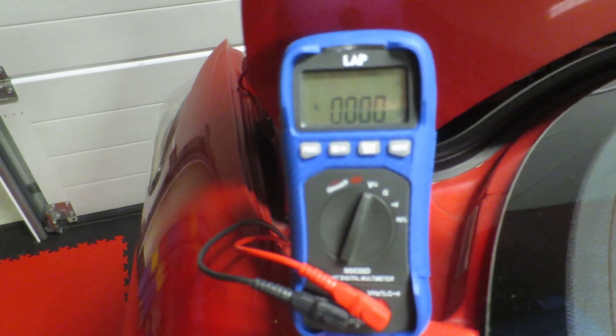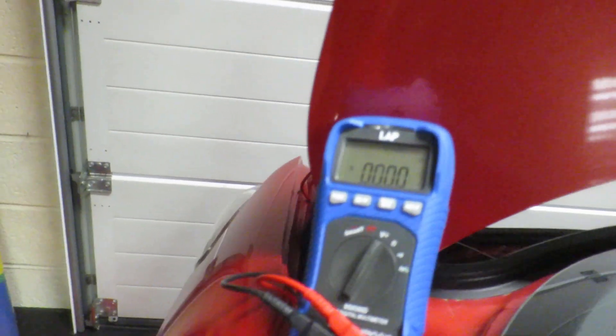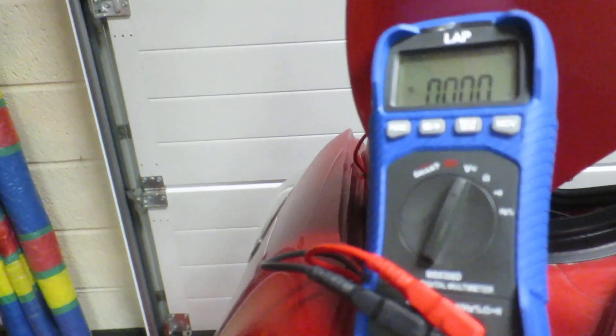I should be able to put the camera whilst turning on the ignition. If I turn the ignition on, I get a voltage which starts off high and then I can see the pre-charge clicking in, and then the full voltage comes in. The pre-charge is on for about 10 seconds but it doesn't get fully up to 380 volts until the main circuit kicks in. I assume that's enough, but if anybody knows different about that behavior let me know. I turn the pre-charge on and then switch it over to main voltage after about 10 seconds.